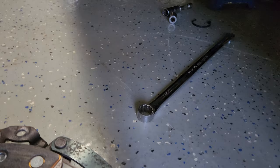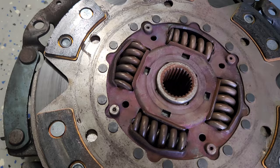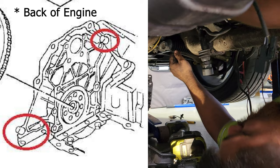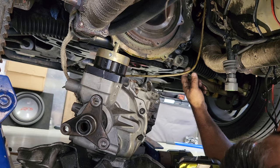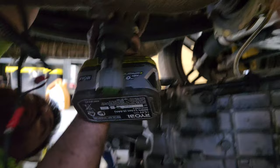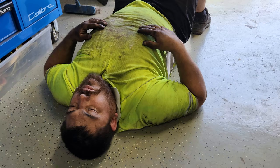The bearing cracked due to an alignment issue, because the dowel pins were actually missing on the back of the adapter plate. Therefore it was out of alignment, but we've got it all aligned now. So now when I put the roller bearing back in, we won't have any issues again. Will we, Shaun? I hope not. Sick, let's pull it out. How you feeling, Shaun?